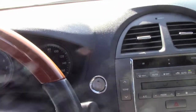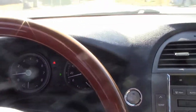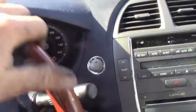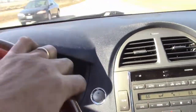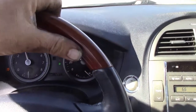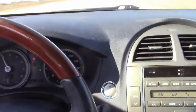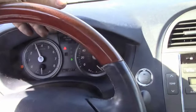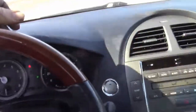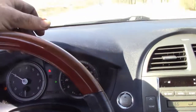And like I say, we're using the brakes relatively hard here. I'm not actually making it so the anti-lock brakes are kicking in. I suppose you could, but just some hard stops, you might be in a semi-panic stop mode. That's kind of what I'm imitating. Everything seems to be working just fine. So I'll do a couple more fairly hard brakes in this car, make sure everything sounds good and nothing's pulling, and then we'll check to see how hot the brakes are when we get home. And if they're not super hot, we'll consider everything good.